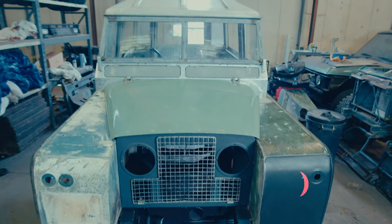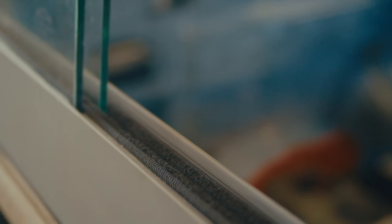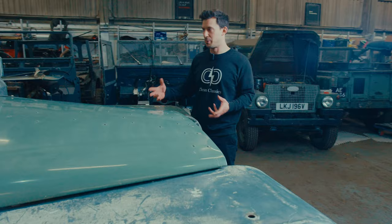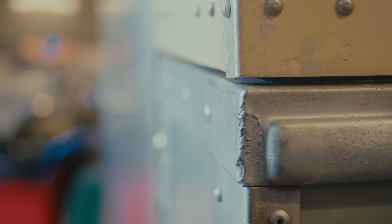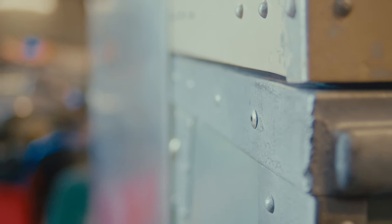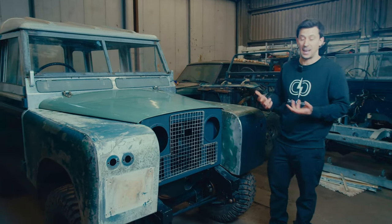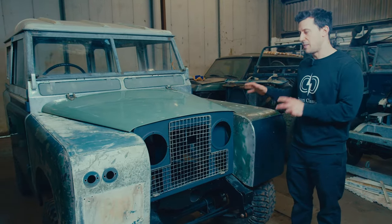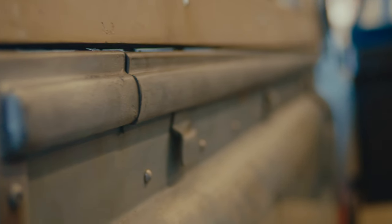The Series 2A dry build is now complete. The purpose of this stage is to bring together various parts we've straightened out and new replacement parts — this is a bit of a mishmash from a couple of different cars. The dry build ensures all the bolt holes line up, everything aligns and works together before painting. Doing that means you avoid risking damage to freshly painted parts — you want to bolt them all together perfectly painted and be job done.